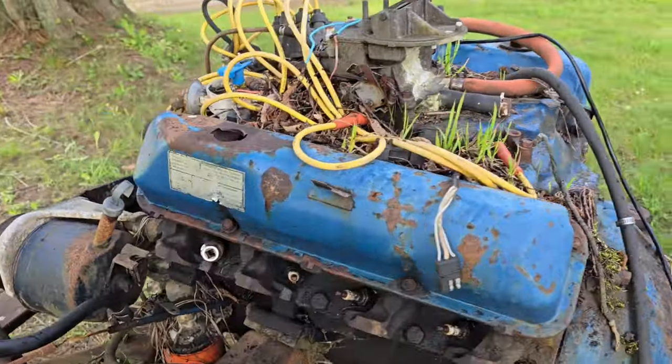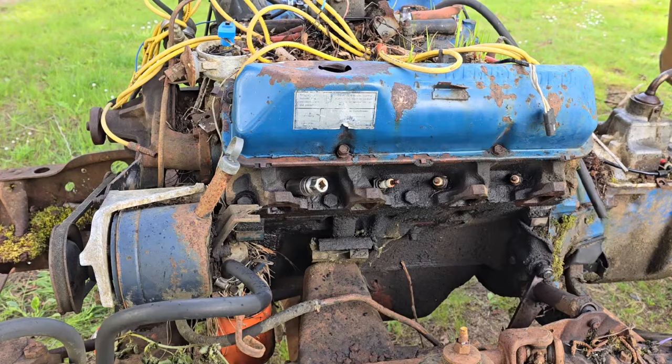But yeah. So anyways, I got a borescope. First we'll pull these plugs out, look down the cylinders, see how they look, spray some stuff down there, mix up a concoction or something, and get the cylinders lubing up, and then we'll pull the drain plug, see how bad it is in there. Then I'll start cleaning off the top of this engine, and we'll pull the valve covers, see what's under there, see if we can identify the motor a little better.